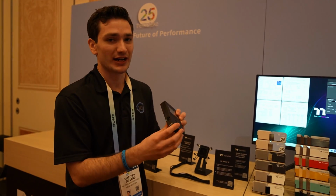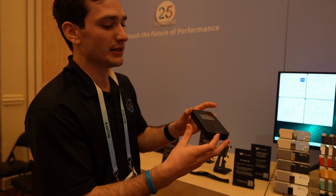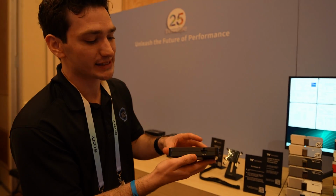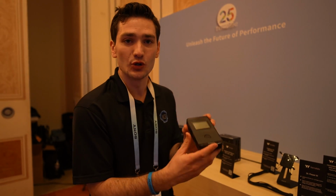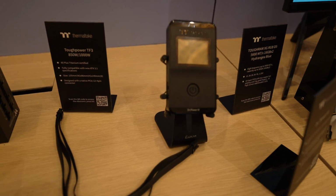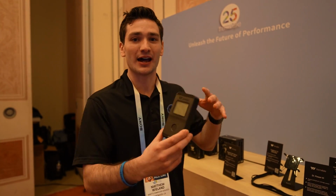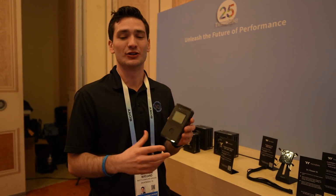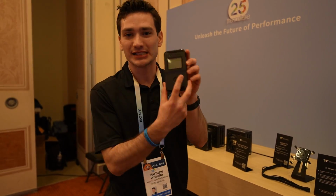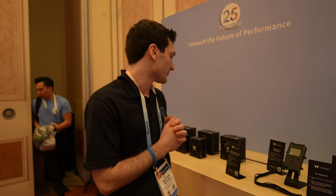And the big thing here is that all of a sudden, we can now do the 12 plus 4 pin, ATX 3.1 standard testing, which we weren't able to do because it was previously limited to the 8-pin connectors. So this is a huge deal, and it's something that I'm going to pick up the second it comes out. I'm super excited for this, and as somebody that works on computers, I really appreciate it. Anybody considering working on computers or needing to test a lot, this is a great product. At least the Dr. Power 2 was, so I'm excited to test out Dr. Power 3.